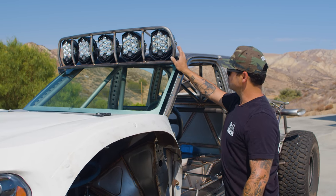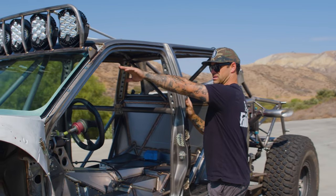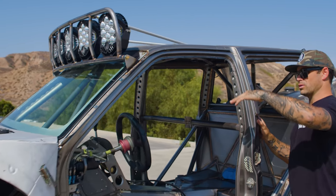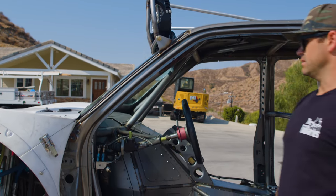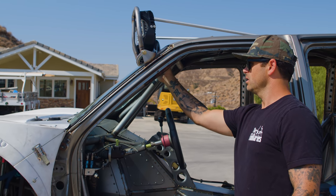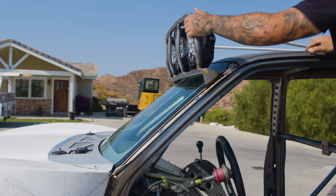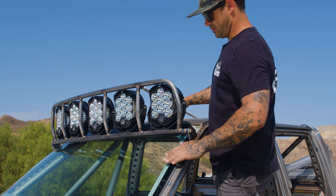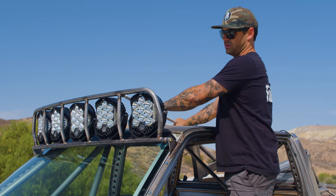This is right at the height of the trim piece for the removable windshield, so you're really not any lower than what you had just from the trim piece, which would almost be like a windshield for a racing application, where you'd have a window trim like that. This whole thing is 1 inch, .120 wall chrome moly. The roll is tailored to the radius on the windshield, and then just simple linkage, solid aluminum bar,